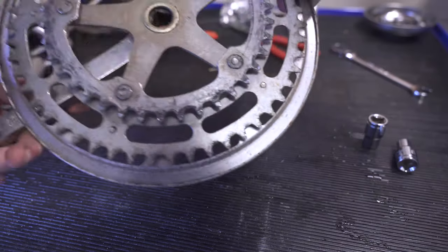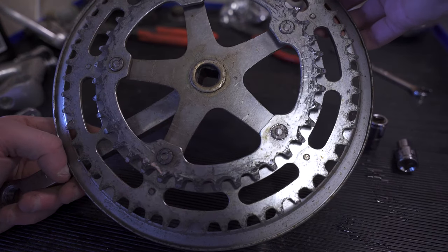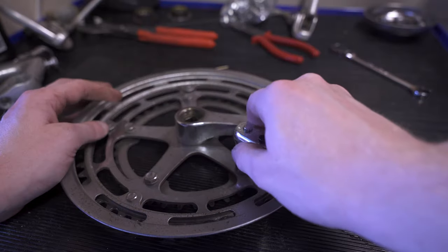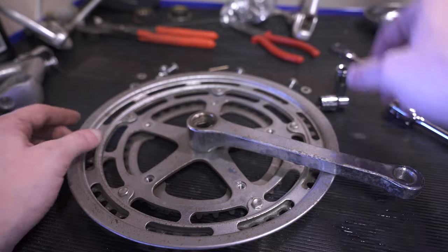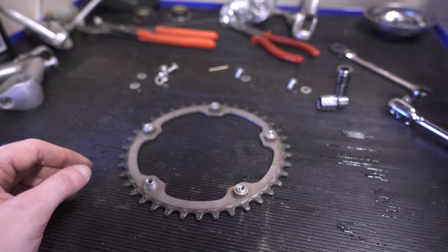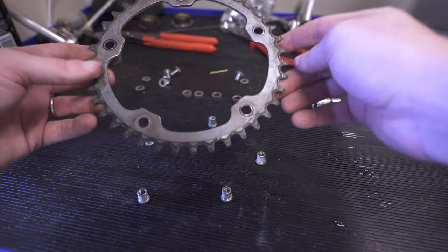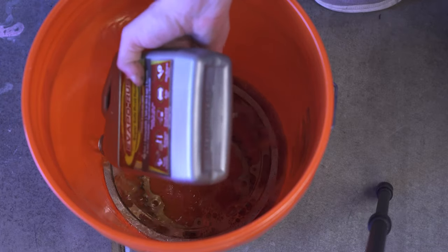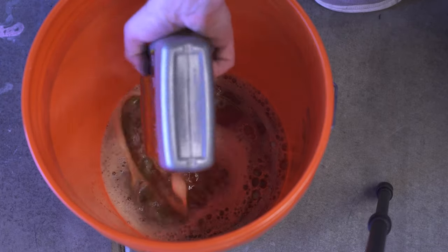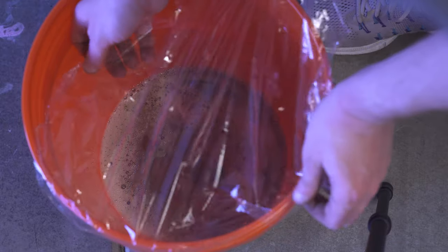Looking at the crank, there's definitely a lot of corrosion and dirt, but it's 40 years old. The first thing is to disassemble it all the way — something you can do on these old bikes that you really can't do on a lot of new bikes. All of these parts are so easy to put together and disassemble, even if you don't have any bike skill. The process is degreaser first, then Evaporust — same Evaporust from earlier — throw it in a bucket and leave it overnight.